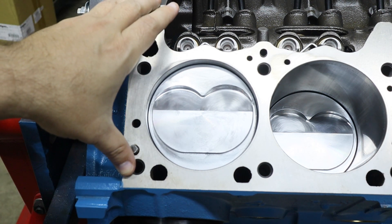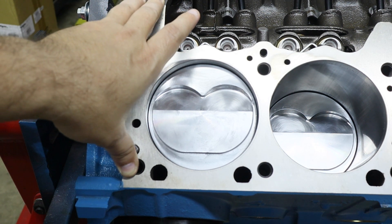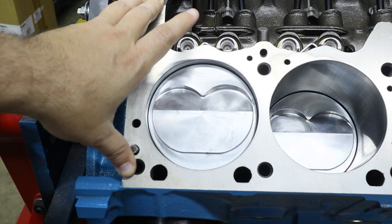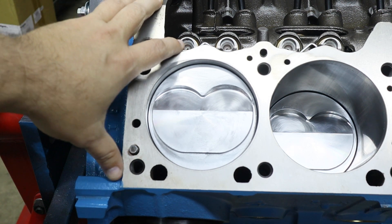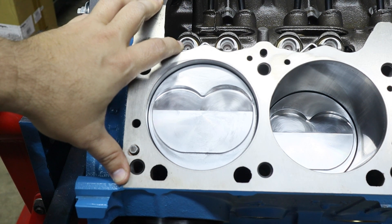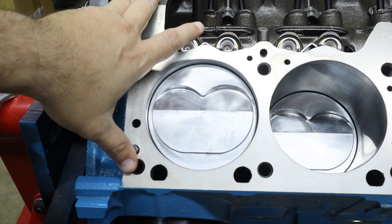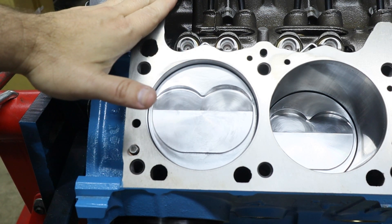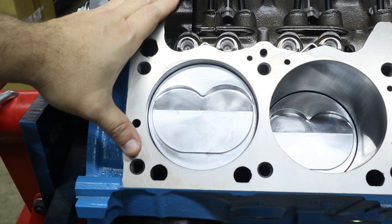This still gives us plenty of room for the higher RPMs we're looking for. It's been a little bit of time since we did some filming because we were waiting on parts. Now we're ready to catch back up and get this thing into assembly today. We're going to tackle getting the head on, making sure the valves are no longer touching, snugging up our rockers and rocker arm assembly, getting our oil in, getting it primed, and getting our intake on so this is ready for the engine test stand.